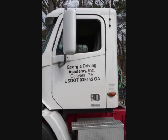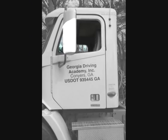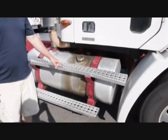Move to the driver area of the tractor. Check the mirrors and brackets to ensure they are not damaged and are mounted securely with no loose fittings. Check the driver window to ensure it is not damaged and has no illegal stickers on it. Check the driver door to ensure there is no damage and that it can open and close properly from the outside. Check the hinges to ensure they are secure and the seals are intact. Check the steps and ensure they are securely mounted.